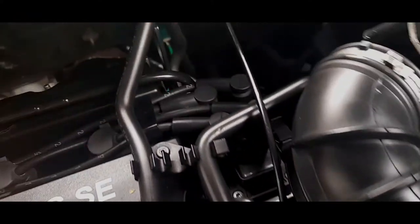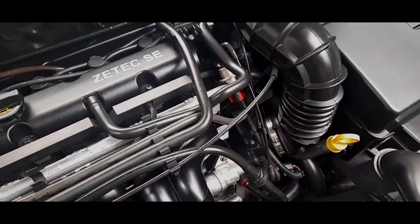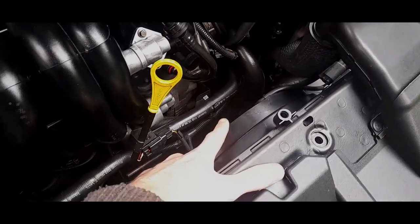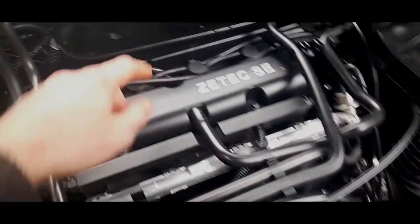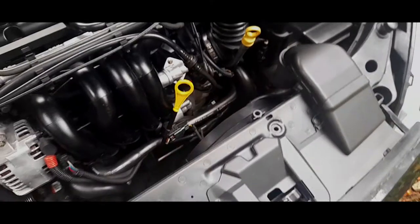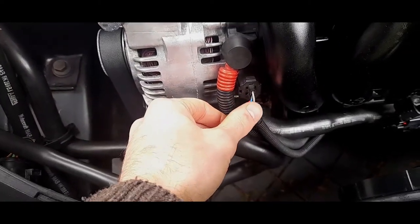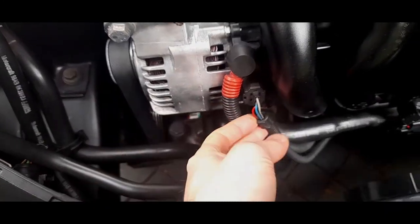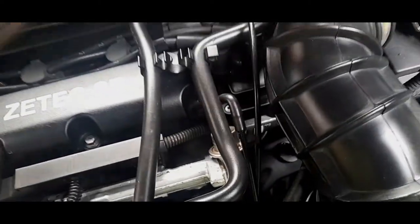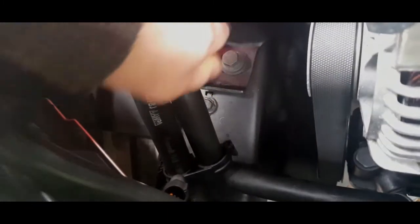On automatic models, a lot of the wiring goes over the gearbox — check that no wiring is rubbing against hoses or anything else as it can chafe. If you suspect your fan motor isn't kicking in when it should, there's an easy test: take the plug out from the temperature sensor between the plugs and the fan should cut in instantly — if it doesn't, you've got a dead fan. Also check that these wire clips don't break; I've got spare ones cut from a scrap yard for that reason. The coil pack wiring at the back can also fray, and there's another earth point on the chassis rail — clean that up.